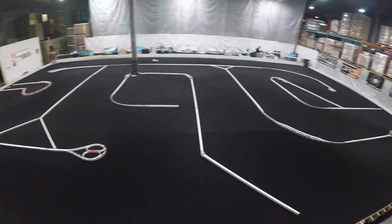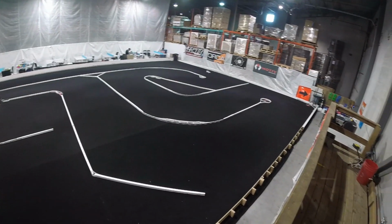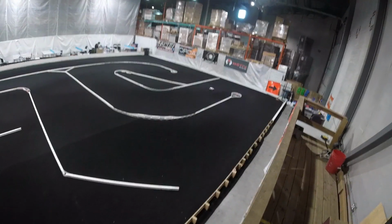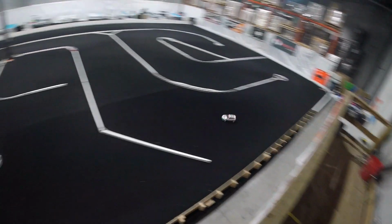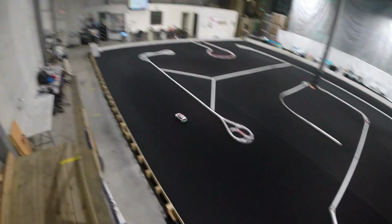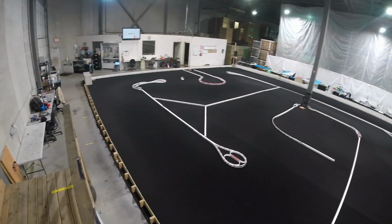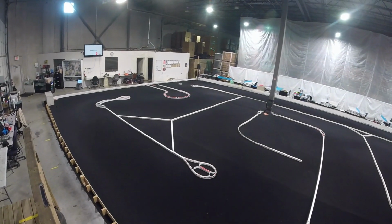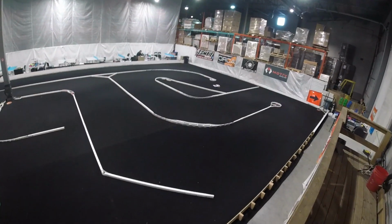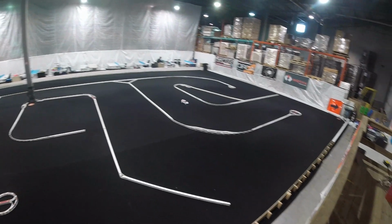On throttle, it'll steer on throttle because again, that rear end has no toe. So when I gas it, it has no problem looping the rear end around. Front end being a spool is always good. A lot more controllable in and out of corners. Without that front spool, I think I'd be looping out everywhere.